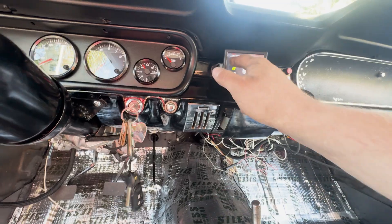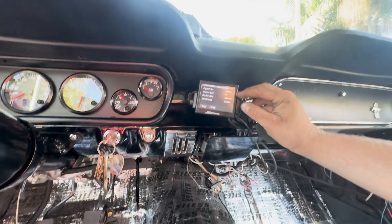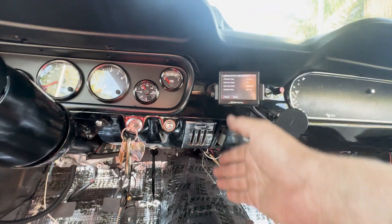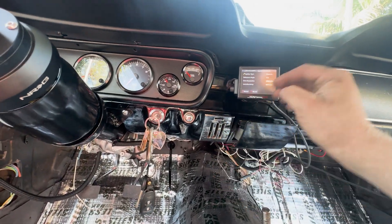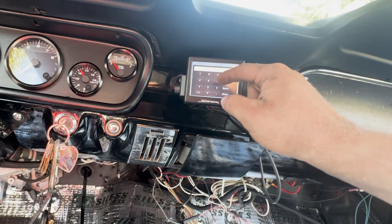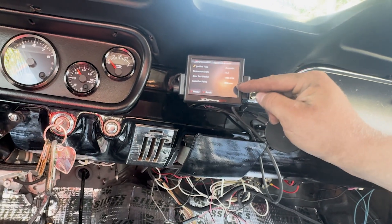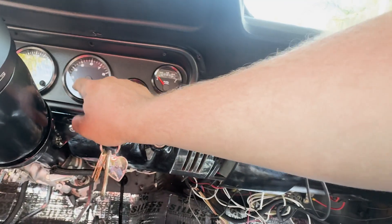With the key on, we go to System Tuning, then Ignition Setup, and make sure ignition type is set to Magnetic. Remember we set the reluctor at 45 degrees before top dead center — that's our reference angle, when the ECU gets its signal from the magnetic pickup, giving it time to react before the piston's at the top. I'm setting the main rev limiter to 5,500 RPM — 20,000 is a little high for this motor. Inductive delay is set to 60 microseconds, which is recommended for use with the Holley coil.